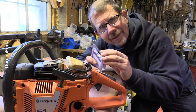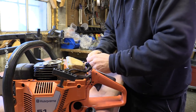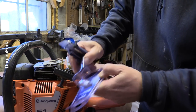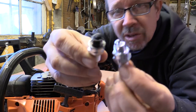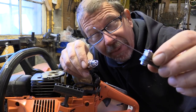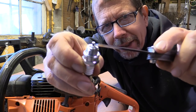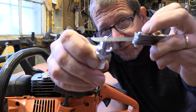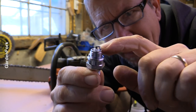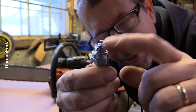So I picked up a new spark plug for this, and there's a key thing that's important when you put a new spark plug in. Voila — new spark plug, a little better than the old one. We wanna check the spark plug gap. You want the gap between the arc that comes over and the electrode to be .020 on this Husqvarna, and that fits in there nicely. So the spark jumps from the center to that curved metal piece — that's why it's called a spark plug gap — and that fires the engine.